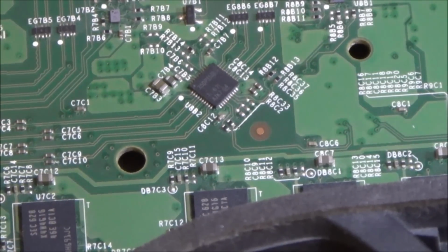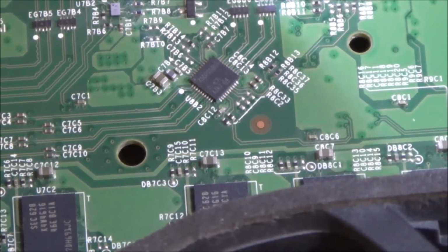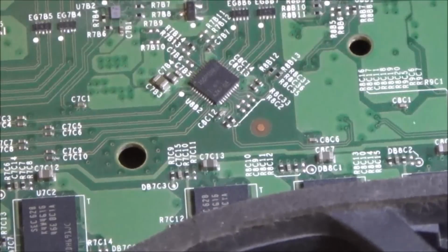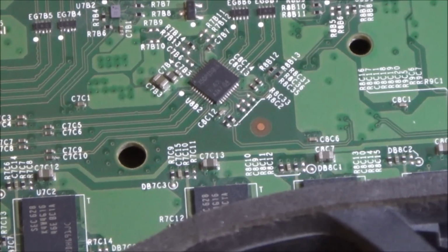Right, okay, so I'm ready to go. I've got the chip here, which I'm going to take out of this packaging in a bit. I've just had a look at it, and the top item number is the same, 75DP159. The bottom 2 lines have different numbers, but I'm assuming that they're just maybe a manufacturing code or something like that. I'm not too sure. Right, okay, so I'm going to get this set up. I'm going to go as hot as this thing goes. I've got quite a cheap rework station, so I'm going to go at 480.